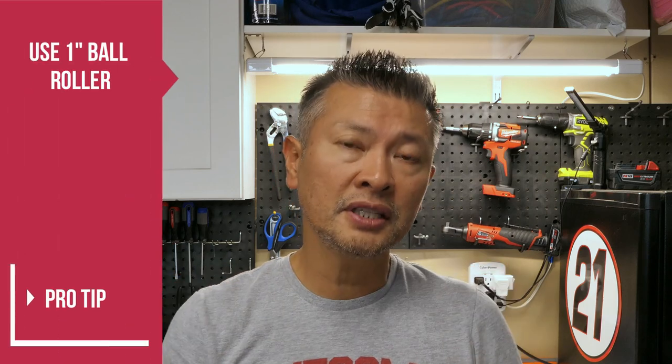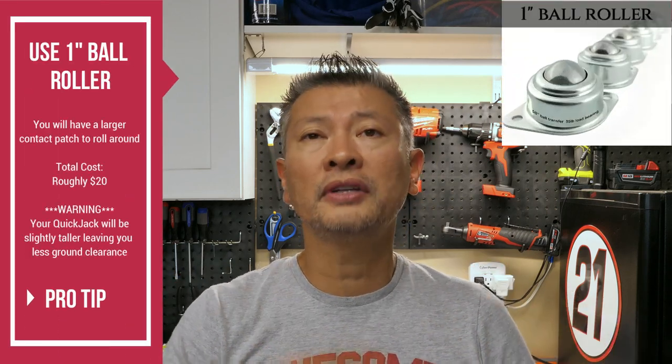But that's not the fault of the little bearings — it's just my flooring is terrible. For you guys who have smooth floors, I am envious of you. I have also thought about perhaps taking that larger bearing that I put in the very back and putting them both in the very front, so that I have more contact with the ground. Because the bearing is larger, it may move a little faster. That might be a revision I do later on, but for the time being I have no complaints. It has made my life so much easier to simply slide things around, and when raising, the main body dropping back onto the ground provides a safe way of lifting the vehicle.